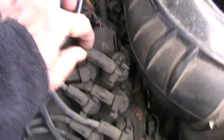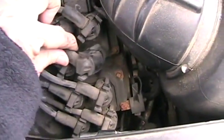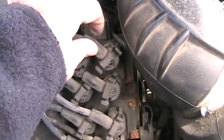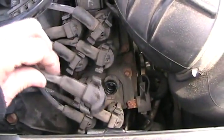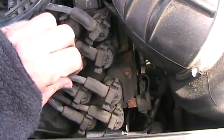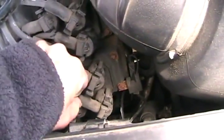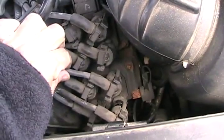That one's working good. Next. That one's working good. Notice the sound in the engine — those are good ones. The engine doesn't change with this one. Not at all. Let's try this one. Definitely a big change. So, it doesn't appear to be the coil pack.